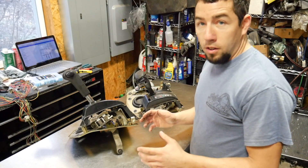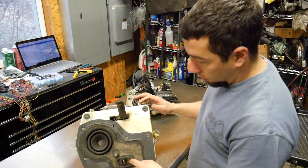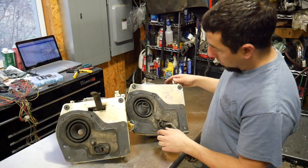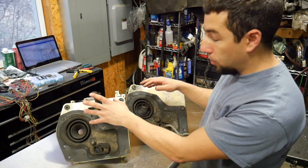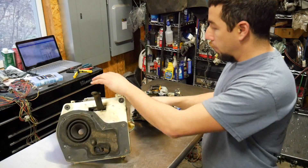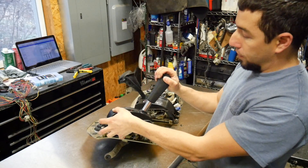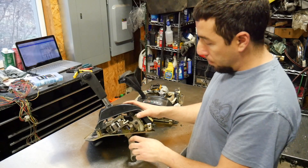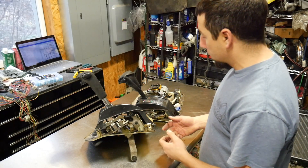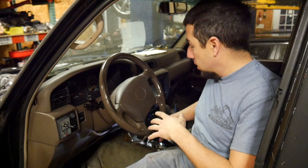I've got the shifter — I'd say further along rather than done. This is the shifter I modified. I've cut my hole, which is probably too big, and there's where the original one came out. You can see you're basically just flipping sides of the transmission. I might have to trim more and bend or cut this, or mount the shift linkage differently — this is the preliminary. What's nice is I just put the hardware on the other side: there's no play, no slop in the shifter, it moves just fine. I'm going to have to do a little math to figure out the swing range of this versus the one on the transmission, and I can adjust both accordingly. I've probably got about 45 minutes in all of this so far.